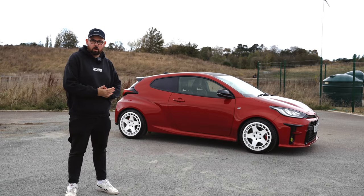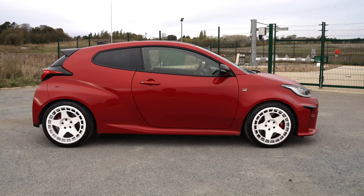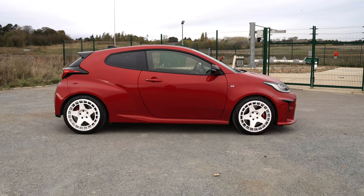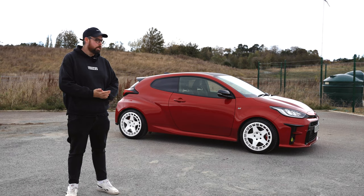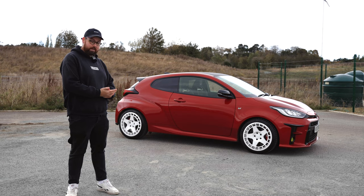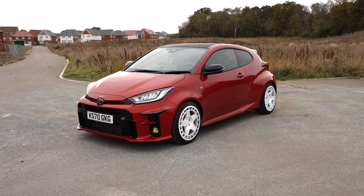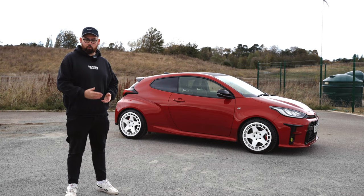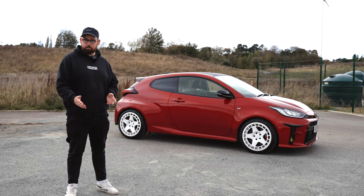What I've also done to the car, which I hope you can see from this angle, is lower it slightly. Rather than going for coilovers, which is quite an expensive choice, I went for the H&R lowering springs, which are 35mm. I was worried it was going to be too low, but in actual fact I think it's come out perfectly. The car looks a lot more aggressive, which is what I wanted, but it's also usable on the road. The ride feels the same as it did from factory and it doesn't scrape on the arches over bumps, so I haven't really got any complaints at all and it looks brilliant.